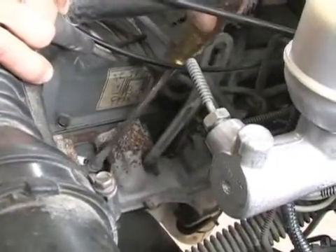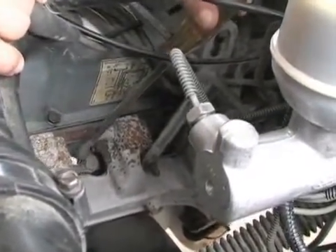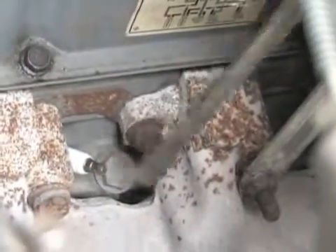At the end of my screwdriver there is this white ceramic insulator — that is part of the spark plug. And then this is a spark plug wire; it hooks on to the spark plug and then the spark is delivered from the distributor out to the spark plug.